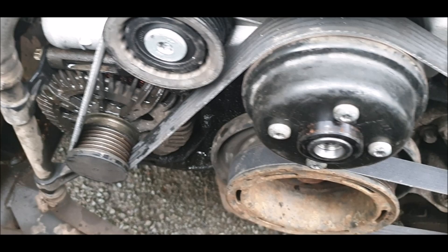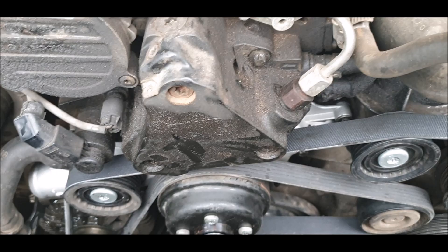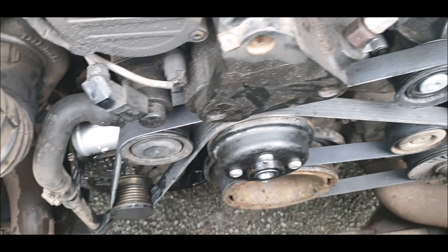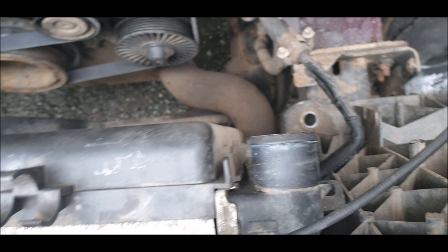And that's where we are. I put the viscous fan cover back on — four screws. The two tensioners are back on, pretty straightforward. Lock them down pretty tight. Two little covers to go back on — just keeps them nice and clean. Easy. I just reassemble now — fan back on, all the radiators are back on. Now I've got to put these bolts back in here. It fits all this back on, it's pretty straightforward — it's just a bloody pain in the arse that you have to take all the headlamps, all the front off. But usually you have to take all this off — we got away with it.